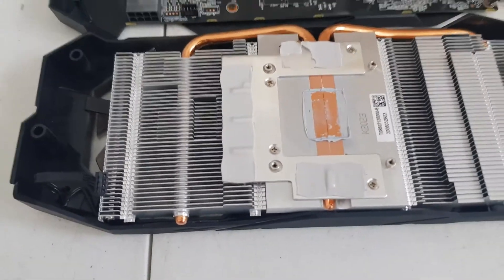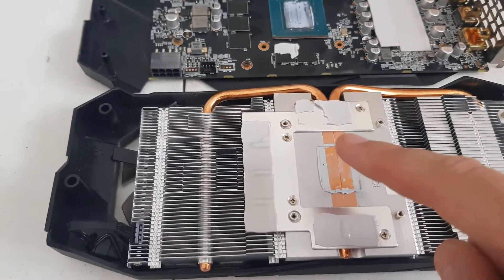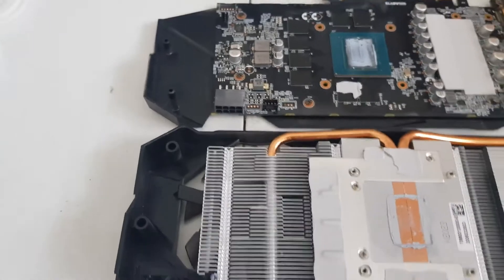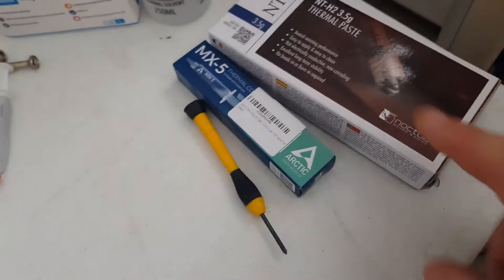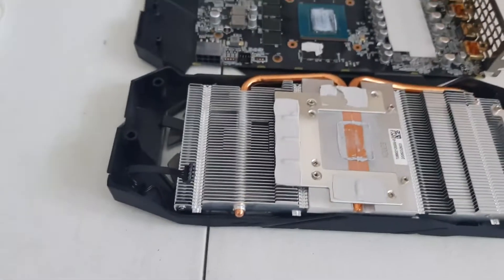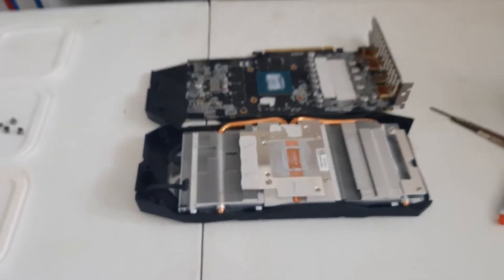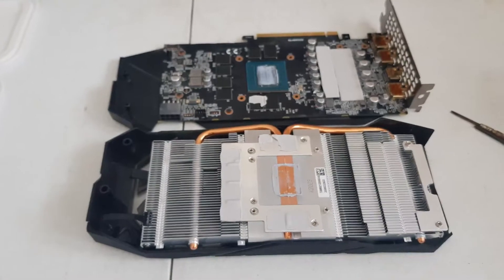I hope that was helpful. I'm definitely going to be changing this thermal paste, and I'm going to be measuring up these thermal pads and ordering some online. I'm going to do a really big deep clean — I've got some isopropyl alcohol, wipes, and some MX-5 and Noctua NT-H2. So we'll get this GPU all cleaned up and back on the rig and hopefully see some improved thermals. Thanks for watching guys — this was just a very basic video, as I hadn't seen many of these on how to open up the RTX 2060 Super.